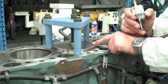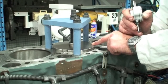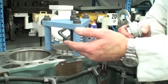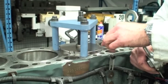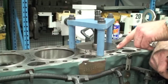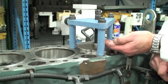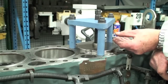So if we only have one thou, we're below the manufacturer's maximum specification. Because the spec says zero to three thou as a maximum and we're sitting at one thou, we're still permissible. If all positions check the same at one thou, then we're okay across the entire deck. If one position tends to be lower — say the manufacturer allows zero to three thou and we had one or two thou on the rest — we may want to bring that one up by putting a one-thou shim underneath that liner to bring the protrusion up to a higher value, so that we have more compressibility on the liner sleeve and it holds it in position.